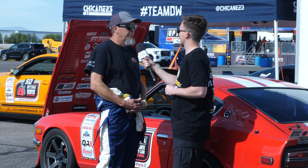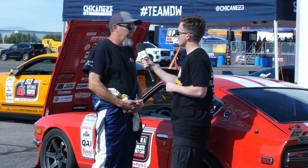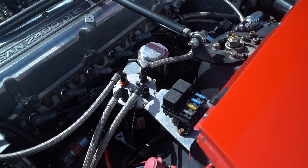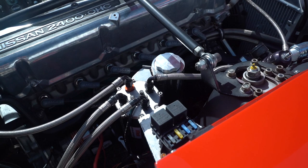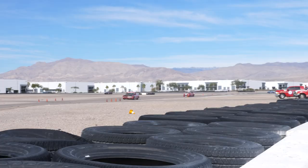One more thing — converting a 1973 vintage car from carbureted to EFI has different fuel system requirements. What did you need to change? Since I already had a fairly powerful fuel pump in the back, I left that and added a surge tank in the engine compartment with a high-pressure, high-volume pump immersed in fuel. The circulation continuously fills it, so I never have fuel starvation. It operates at 50 psi to feed the EFI. There's probably some fuel slosh, but since it's continuously filling that surge tank with a high-volume pump, I've had no issues.